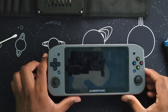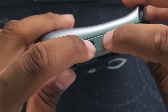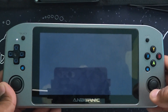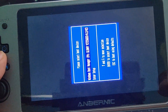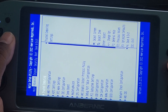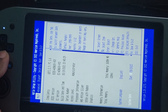Now it's time to overclock the RAM module. To get into the boot screen, you need to hold down the power button, then the volume down button until the screen turns on, and then release both. Go to Enter Setup, click English, then go to Advanced, and then go to AMD CBS.